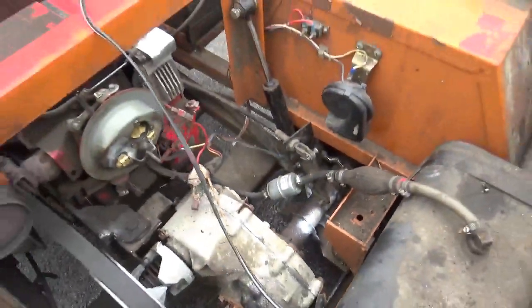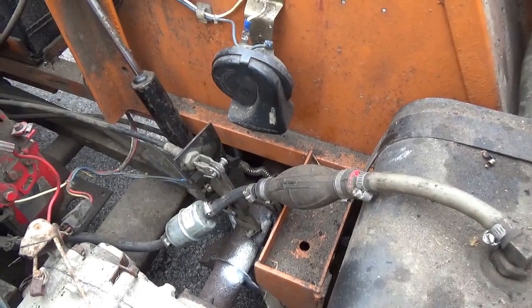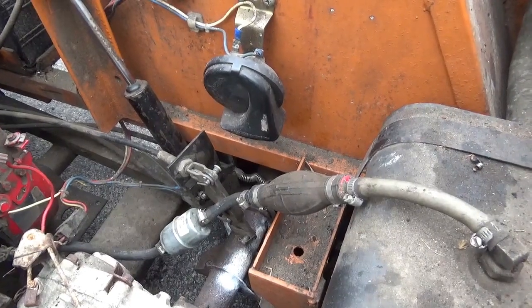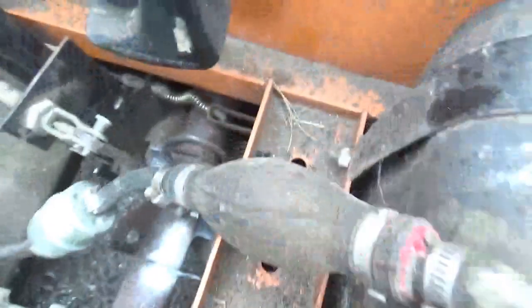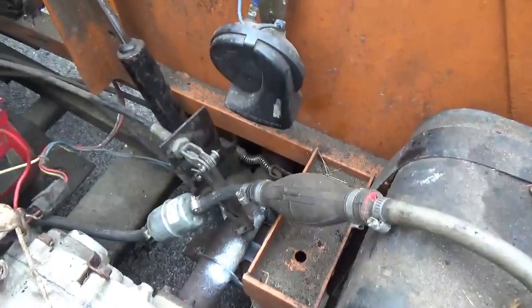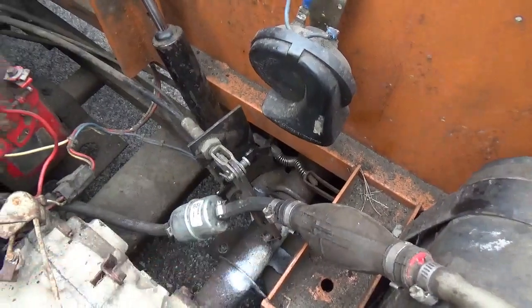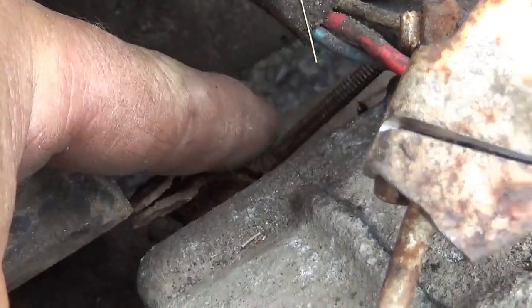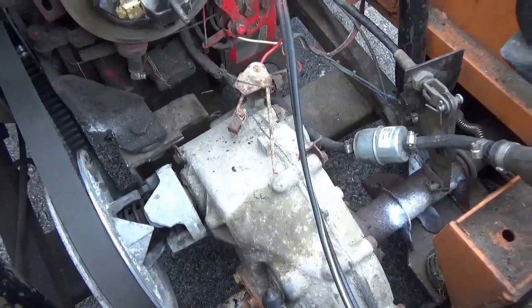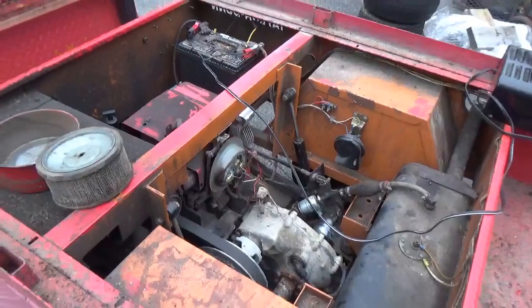To move it this way I actually had to take the brake apparatus off that wheel — the little lever you pull on to apply the brakes. As of now there's only one U-bolt on each side holding the axle on. I'm just making sure nothing's scraping. There's the linkage for forward and reverse, and there's really no way I'm going to squeeze it on there, so I'll have to do something different. You can see the little spring right there holding it in forward — so this thing went from only going backwards to only going forward. I need to smash the air cleaner on and then we'll take it out for a ride.